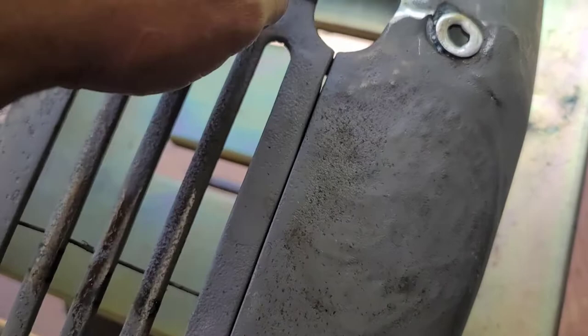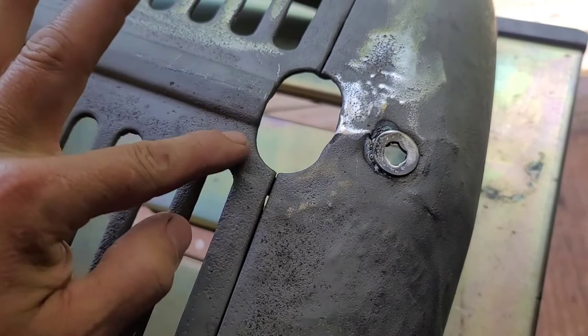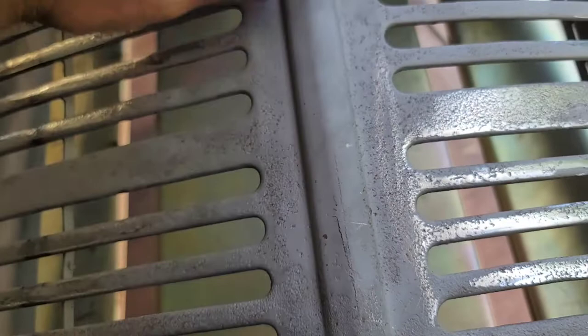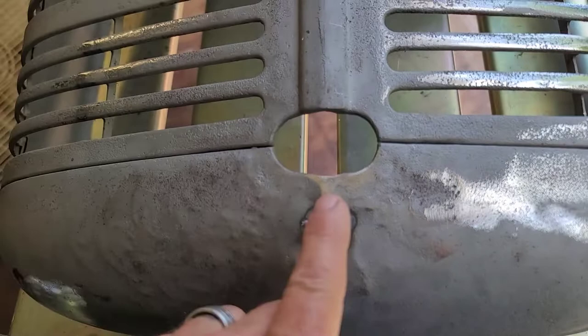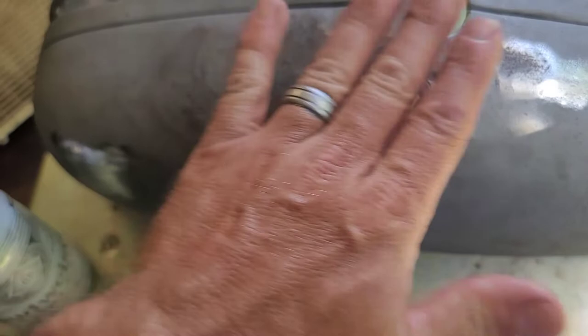Once I re-strained and re-welded it, it actually helped bring these back to where I wanted them. This side over here was really, really bad — there's a steel ring underneath here welded in, and trying to get this all pounded out straight was a serious chore. This right here was all the way in about here — it was done in really bad — and the front bolt and washer ripped through. The bracket on the inside was bent up; these are actually factory stamped, kind of embossed around here.